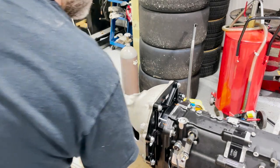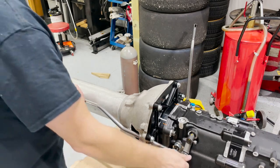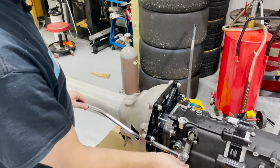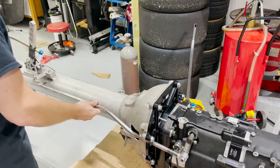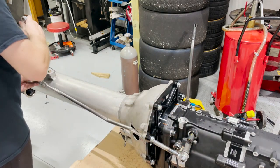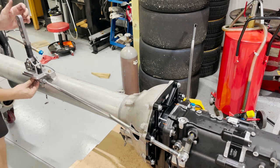We got the rod welded and I cleaned everything up, took it apart, cleaned it out, and now it's back together for final assembly. I did use some washers on the inside of this — I didn't like the way it positioned, and by spacing it out this way it keeps it off of where it goes through here. It's a little bit better, I think. Once this is on, I'll angle it up just like this — what that does is allow it to clear when it shifts back. It's held in with the pin and the cotter.